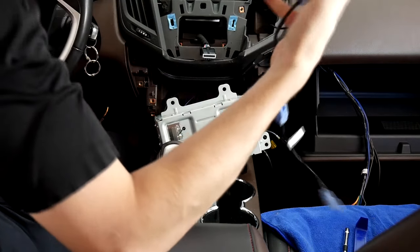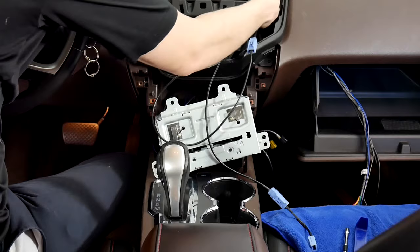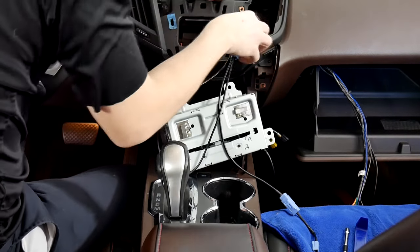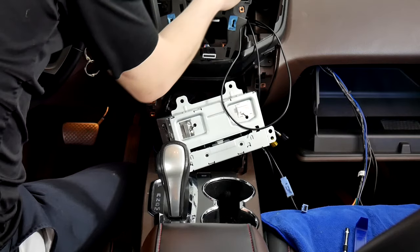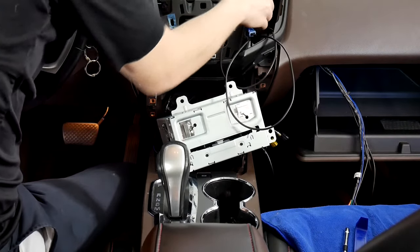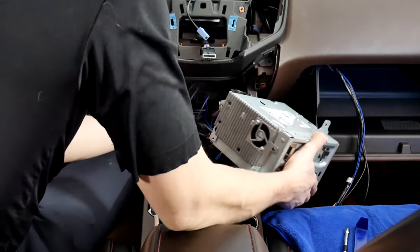We've got into the glove box. We've got these two cables here for the video, so let's hook those up. This side is coming from the radio itself and going into the screen. Take the female end and go up behind here — you can also lift up on it a little bit for more room — then run this cable up through there. Once we've got the female through, just plug it up and tuck it to the side. We've also got the male end in here that we need to hook up, which is going to plug into the screen. We're going to put the radio back and tidy up the ground wires once the radio is back in.